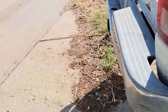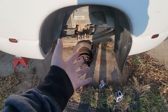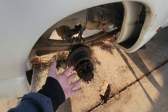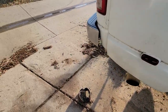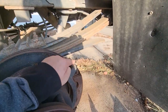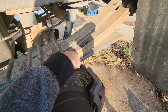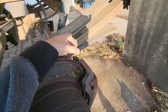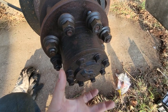This side is done — that's what I didn't do on video. This side I will do on video. I did the other side like two weeks ago. This side is mostly complete, I just got to change out those bolts right there because that one is broken. So this side I kind of have an idea what I'm doing now. What you gotta do first is take this off — pretty self-explanatory — but this bolt right here kept running into the leaf spring, so there's two bolts on the back of this main bracket and I'm gonna take that off as a whole unit, then separate the two.